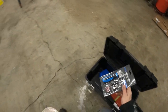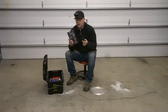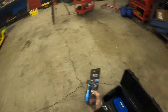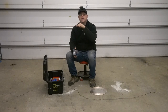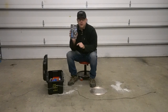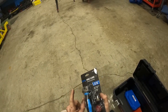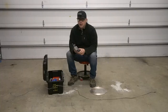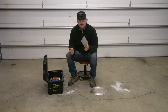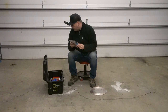This tool right here is pretty cool — I haven't even used it as you can see, because I usually pull the lines out. But I picked this up in case I need it. There are many times where you're just sectioning a line and want to get something back on the road quickly. This is a high quality clamping and flaring tool that really clamps the line and lets you do a really high quality flare on the vehicle. Cut the line nice and straight, deburr it, use this tool to flare it.